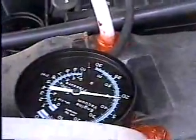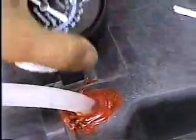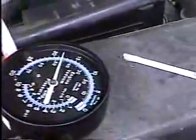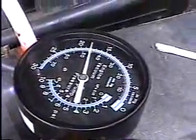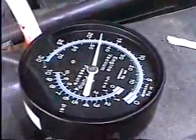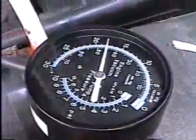Now we'll go over and look at that gauge — it's upside down, let's see if we can turn it around. You can see it's at 22. Normally, if I did not have this set up right here with this second valve going into it, going down to the air plenum box, when I accelerate it, this would drop down from where it's at now — somewhere in the neighborhood of 20 or 17 inches. When I accelerate, it would go all the way down to seven, but watch it now.